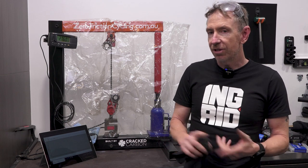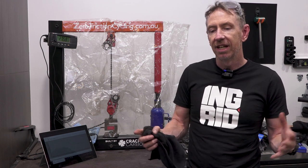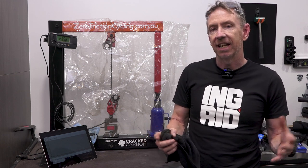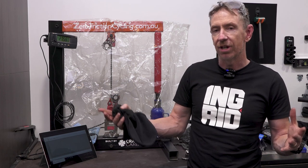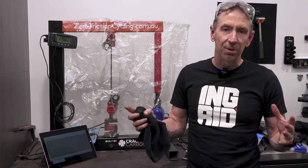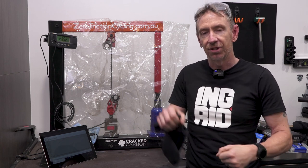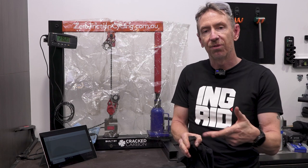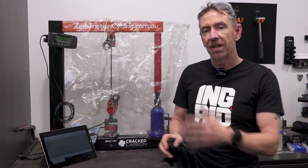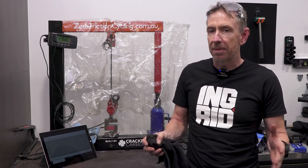So electronic shifting has really exacerbated that. In the days when everybody was on mechanical shifting, there were, I guess, fewer failures than with the advent and very wide adoption of electronic. People tend to shift now, especially on the front, under loads they never would have dreamt of back in the day of mechanical, where you could feel the tension you'd have to put through your lever, because the harder you're pedaling, the harder that chain is stuck on the small ring, and you have to use your own force through the lever to get it to shift up onto the big ring. And there was just really a limit to that. The feedback would let you know that it was too much pedaling power.